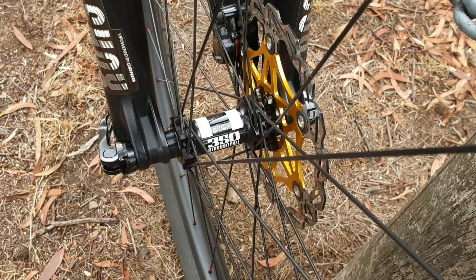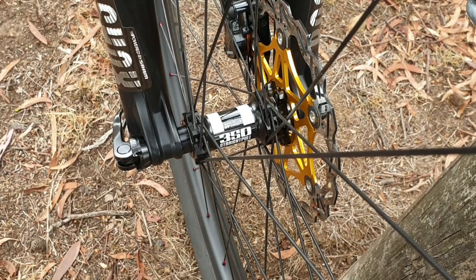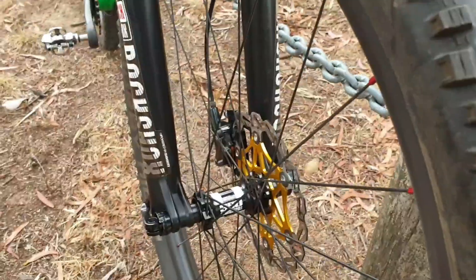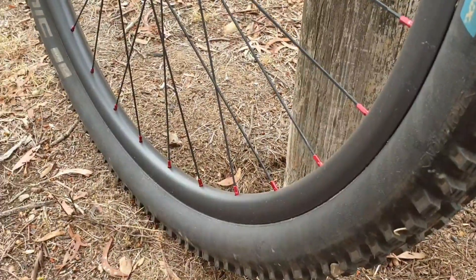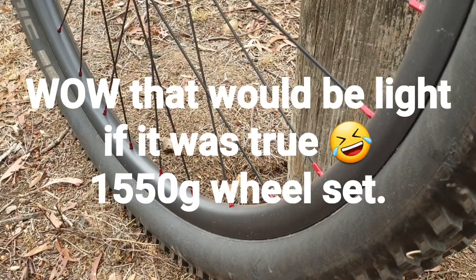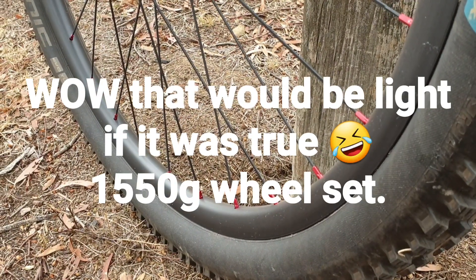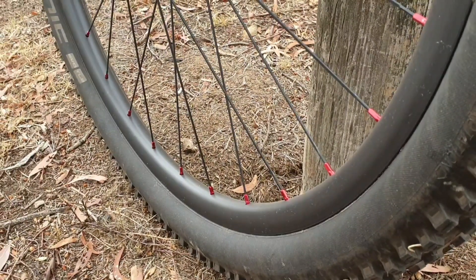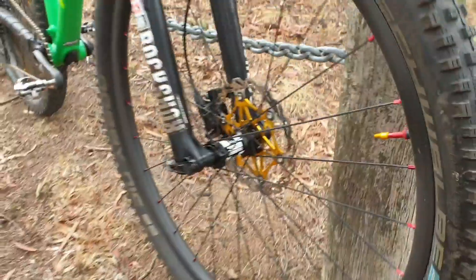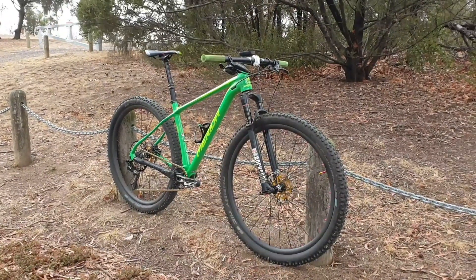The front is slightly wider on the braking side than on the non-braking side, which allows it to centre the rim quite nicely and build a stronger rim. These rims are 24mm deep and 30mm wide, 24mm on the internal. They're a 550 gram wheel — with no valves and no tape in there either. I could have got them all the way down to about 1200 grams for the pair, but I took a middle ground going for a combination of light and maintaining strength.